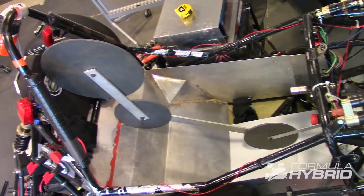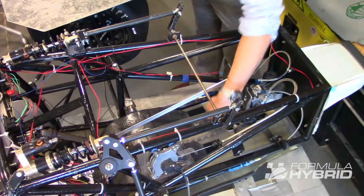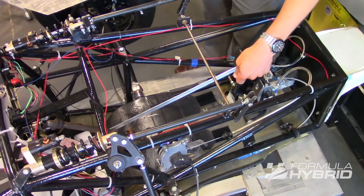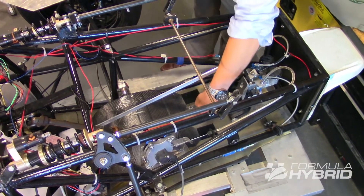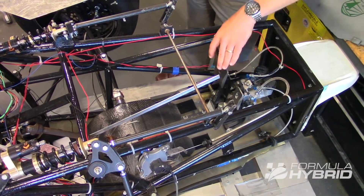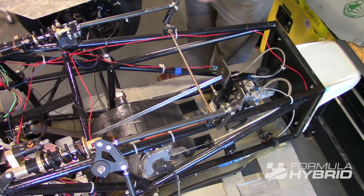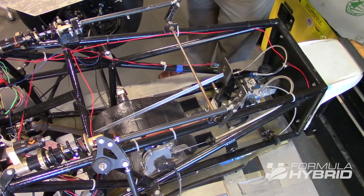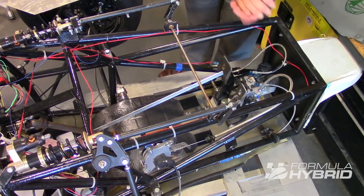Moving forward to the feet, PERCY does have a foot, and therefore at 36 inches forward of PERCY's hip point, you have to have the foot elevated off of the floor and preferably sitting right on the rearmost pedal. In this case the brake pedal is the rearmost pedal, and you can see that the entire pedal package is in fact sitting in its foremost position.